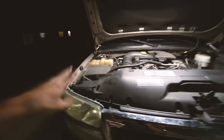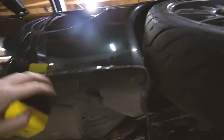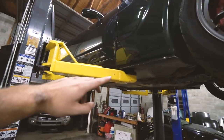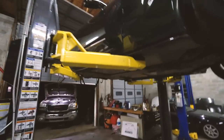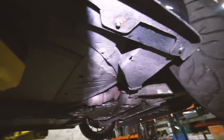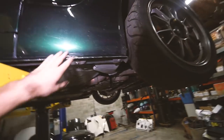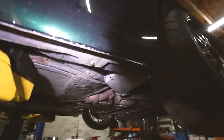Still got to do brakes, still got to do trailer stuff, but that's okay. Moving on to the vet. What I want to do is pull these side skirts off and just remount them with riv nuts — it's a more permanent solution. Up here you have the factory bolts, but then I self-tapped it over here and occasionally they'll want to pull out if you scrape over a speed bump. So we're just going to make it a little nicer with riv nuts. The only reason I didn't do riv nuts in the first place was because I didn't have any, but now I have them and they're my favorite thing ever. Got them riv-nutted in all the way around — they feel much sturdier now, which makes me happy. So when you get the car and scrape over speed bumps, you'll be all right.